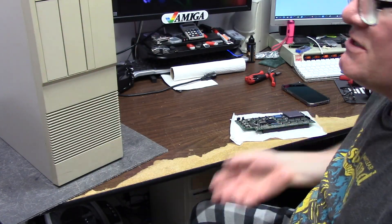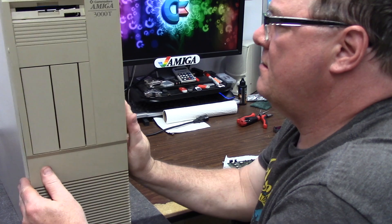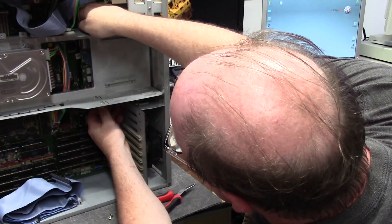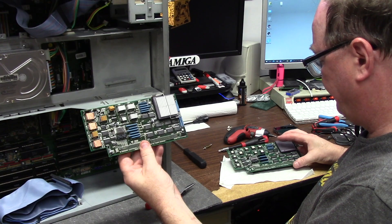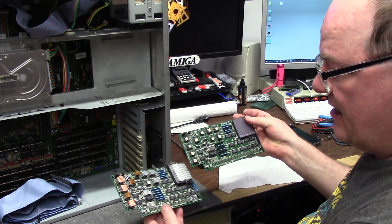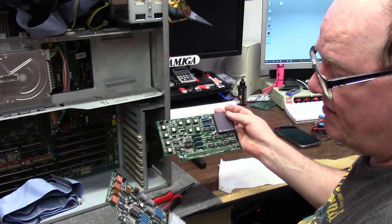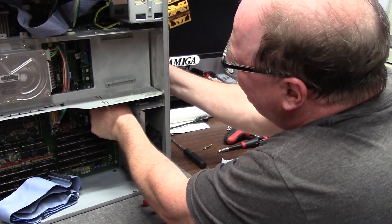I figured what better machine to test it on than my 3000 Tower. So I'm going to remove this carefully — two screws in the front, two screws in the back. All right, carefully down. This is my 3640, this is the repair 3640. They're both rev 3.1s. Mine looks like Mr. T got all the heat sinks on it — this one does not. They have the same wires except this one here — U203 has a different one. Let me carefully fish this up here and shove it in. Did I get that on the first try? Sure did.